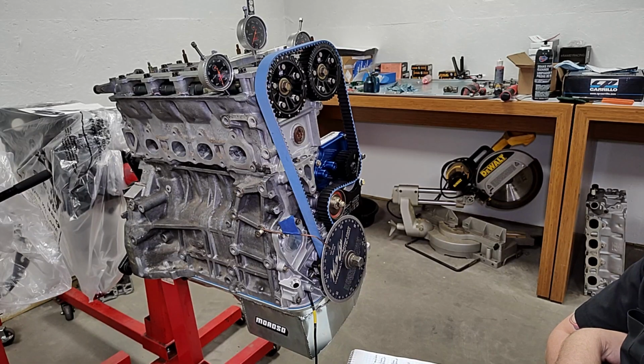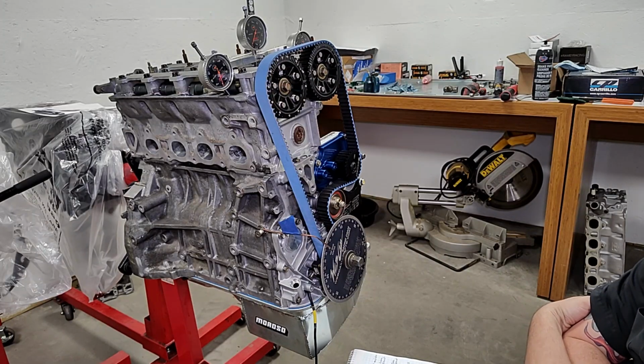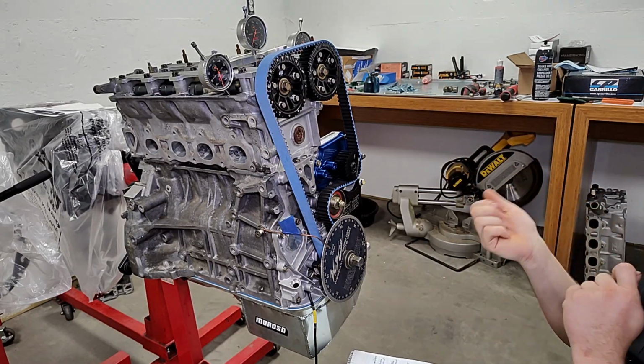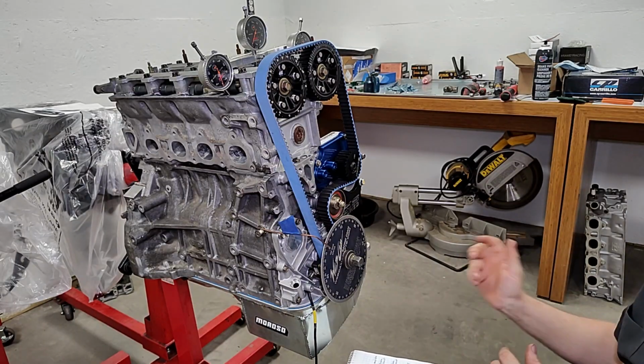horsepower, does that get amplified as power goes up? Yeah. So it's like an exponential growth. You lost 10 horsepower, and then as you move up, that turns into you lost 30 horsepower, you lost 100 horsepower. Yep. Because our turbos are so big that our efficiency range is so high in the boost level that any little thing we can do to get the air in and out more efficiently really matters.